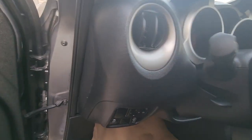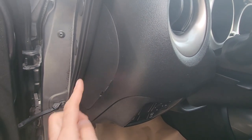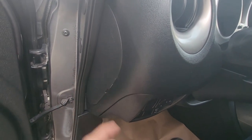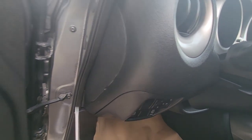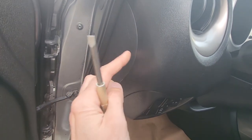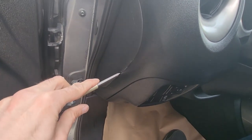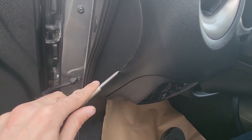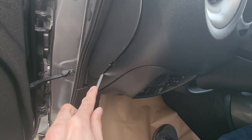The fuse you want to check will be located in a fuse box in the passenger's cabin. It's right here on the left side of the vehicle dashboard. To remove this cover you just want to pop it out. There are a bunch of plastic tabs holding it, so you want to use something like a flat screwdriver, or even your finger, to pop it out all around.